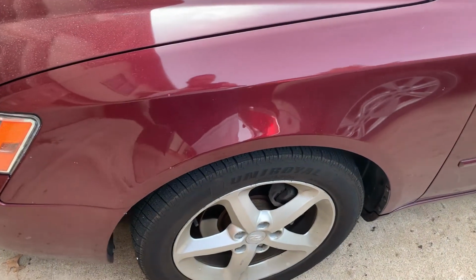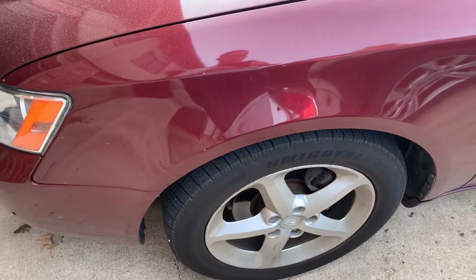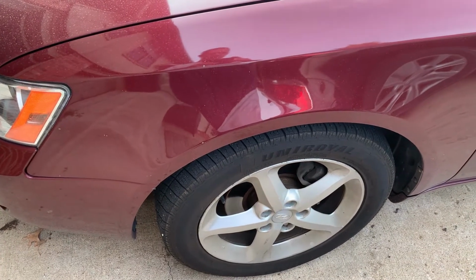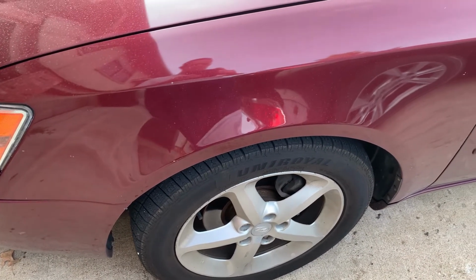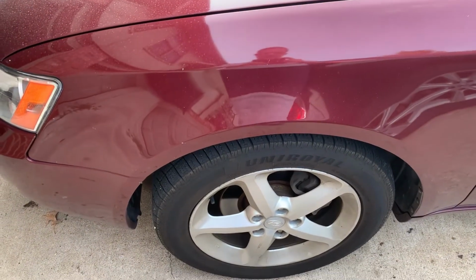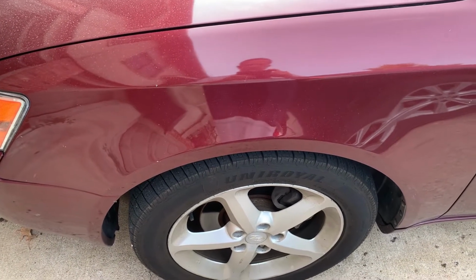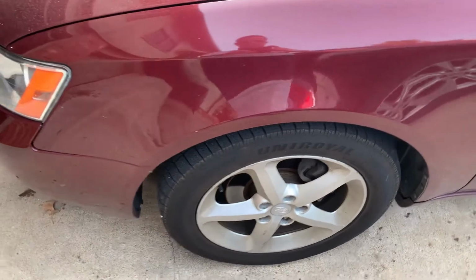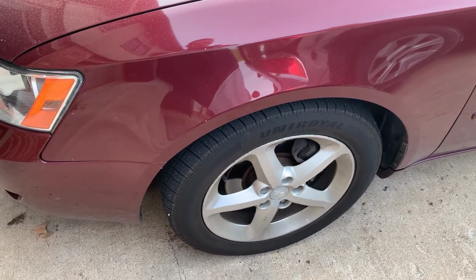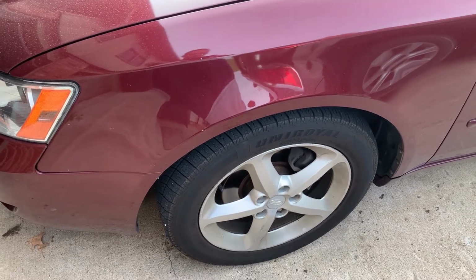But what we have to do today is a suspension rebuild on the front. It's got a lot of clanking and just noise, and it's more than likely ball joints that are expired. Pretty common failure points on these cars, and this one has like 113-ish thousand miles on it, so it's due for some new parts. It's pretty straightforward suspension stuff, just a lot of bolts and high torque, lots of rust, probably trying to break them loose, but whatever. See if we can work our way through it.